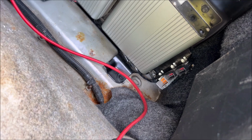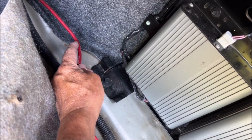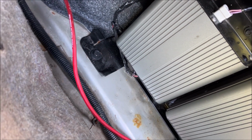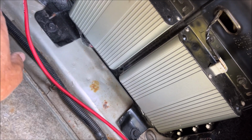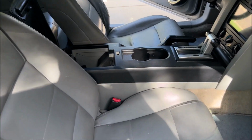I guess I'm doing a splitter, so I could probably cut it maybe up here and then go into the splitter, and it'll go into 2 10 gauge wires, and then to 2 of the terminals here, and then the other wire is going to have a splitter go into 10 gauge and go into the other 2 power wires in the harness, and that should do it.